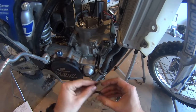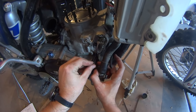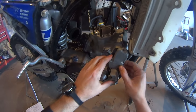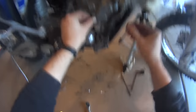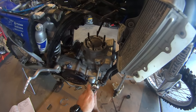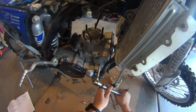It's time to install the cover. This cover has a special rubber gasket for the bottom part. I got it cleaned out - not as good as I wanted but there's really very little movement here. This one installs over here like this and just keeps the oils and stuff in. It has a certain shape that it has to fit in. And now this power valve cover - the mechanism, the linkage for the power valve, fits in here. And then the four bolts that I saved go in here at 43 inch pounds.